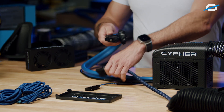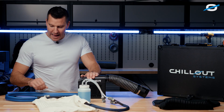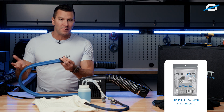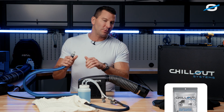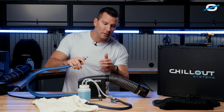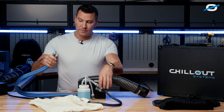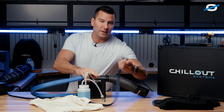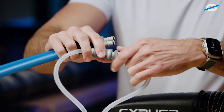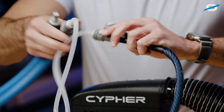I'm going to move that out of the way and plug this shirt right back up directly to the system. Here's another unit with our second most common fittings for this system — again, there are no drips, but these are the ones that don't pull away with three pounds of pressure like the flow lock. Basically, you would need two sets of no-drip fittings — the male side goes on the system itself and the female side goes to the shirts. You need one more piece of the no-drip connectors in order to connect the kettle.